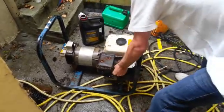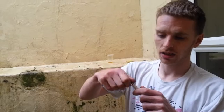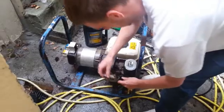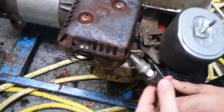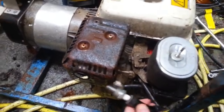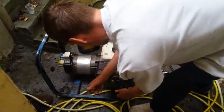Alright, now we've removed the spark plug. You can test the spark plug - obviously if you've got a spare one sitting about that doesn't fit, all you're going to need to do is just take off that little bit there and you can apply it to pretty much any spark plug. Just put it into the HT lead right here. So what we're going to do is put the spark plug in the HT lead and put it up against something metal. We're going to get a spark because we've obviously solved the problem. This is what you're looking for - just that spark there. Now sometimes you're not going to get that spark - obviously that's the problem. So we want to test to make sure that we've got that spark.